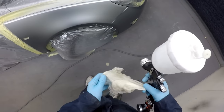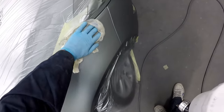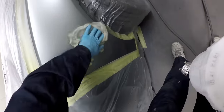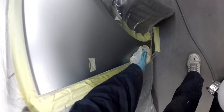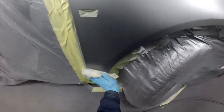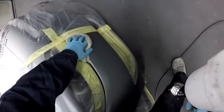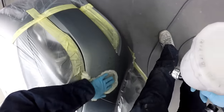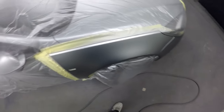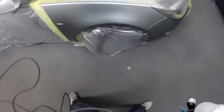For the clear coat section I'm using the DeVilbiss GTI Pro Light with a 110 air cap in a 1.2 mil setup rather than 1.3. I've found the 1.2 setup is really nice — you can get a really fine wet coat of clear down with it and pick and choose your finish a little bit more. Because you're not putting on so much build, it's easier to get that factory finish, and when you want something flatter you can just turn the fluid up a little. The 1.2 atomises really nicely.